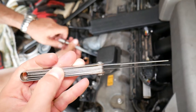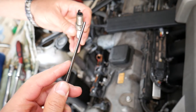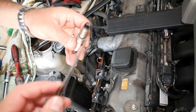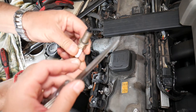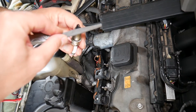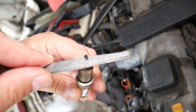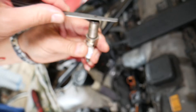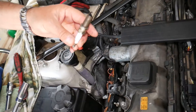According to the specs for that engine, the gap should be set at 0.043 inches or 1.1 millimeters. Ours measures 1.1 mm — right on the spot. Ours is definitely good; it's only about 15,000 miles out and still great.